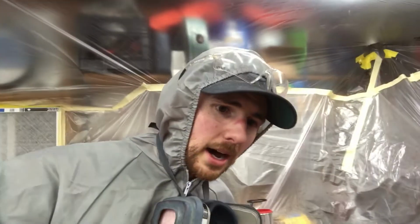So knock on wood, things are going smoothly so far, aside from that one little hiccup of the poly falling off the wall. Yeah, I got 3 coats on there, don't quite have coverage yet. Sikkens reds sometimes take 4, sometimes 5 coats to get coverage, which isn't great, but it is what it is, nothing you can do about that. Aside from applying a darker colored sealer, which in this case we didn't seal.